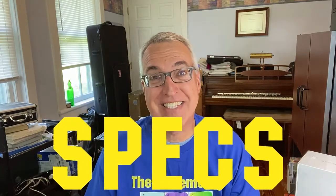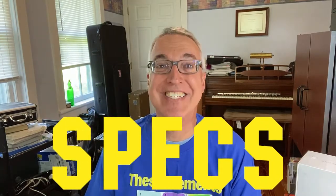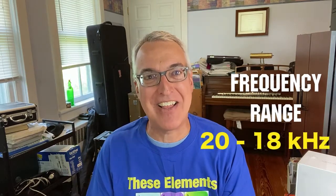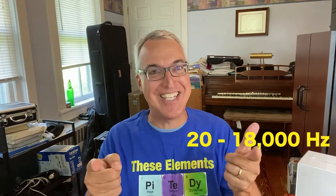Okay, let's discuss the technical specs of the microphone. In terms of frequency range, this microphone is rated at 20 hertz to 18 kilohertz, or 18,000 hertz. I'll take it, because on the best day of my life, my hearing range is probably 20 hertz to maybe 16,000 hertz. Humans, in general, we say their hearing range goes up to 20,000, if they were in the prime of their teenage years, before the cartilage in their eardrum gets stiff. So all that to say, this microphone does cover a human being's hearing range.